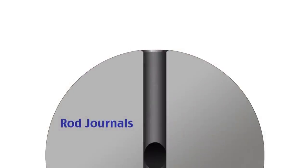It's called a chamfer. The factory crankshaft design has a shallow chamfer on the oil holes. The chamfer is a radius cut between the journal and the bore of the oil hole that aids with the oil supply's transition to the face of the bearing. On a DSM, it's not directional — it's concentric and an even shape all the way around.